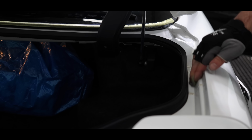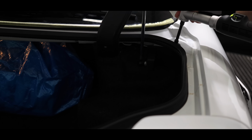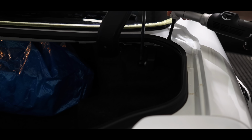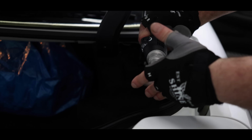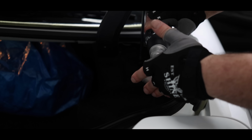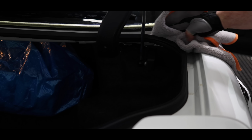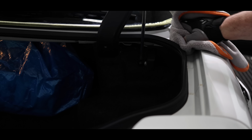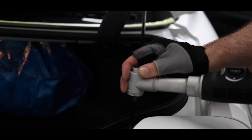You can certainly work by hand if you wish, but if you do have a small nano polisher, it can help speed up the process. In this case, I used a primer polish that'll polish and protect the paint in a single step with a gentle polishing foam pad. Technique wise, I'm only using light to moderate pressure and moving quickly to be in line with a gentle technique. We'll have a look at the door jambs in the final footage, but I think this final polishing step really helped to further clean, brighten and just crisp up their look to make them really pop in the end.